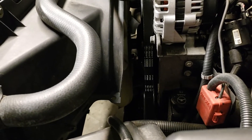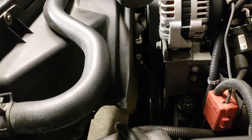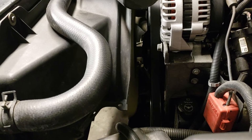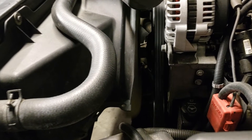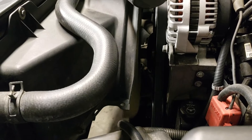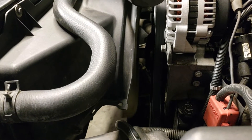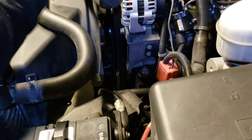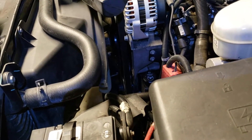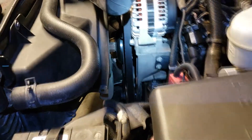Let's see if it squeaks. Not a normal squeak - yeah, but that's what it did last night, and then all of a sudden it went away. So if this fixes it, it was either the problem I found and fixed, or the belt - because we were putting a Ford part on the Chevy. Let's hope that's what it was, because man it's so annoying. It might be fixed, buddy. You're welcome. I'm glad I saw that on that pulley. I've never even thought about that - usually you'd see the belt moving side to side, and that's what makes it squeak.